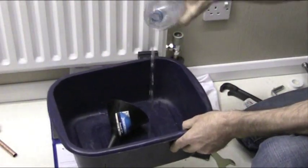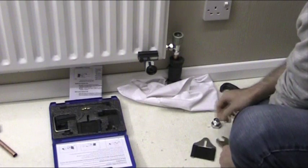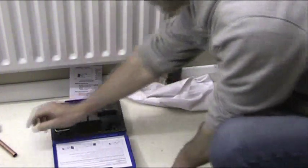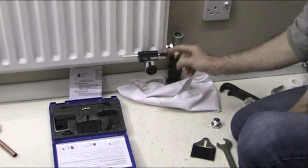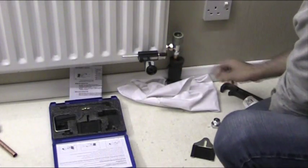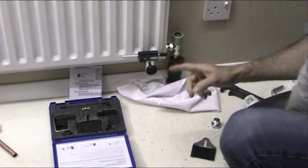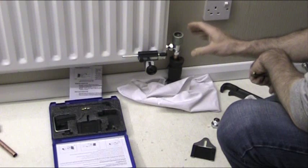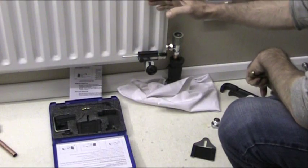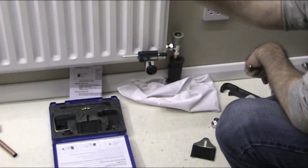Just to show you that it's not a trick bottle. So like I said, the next thing to do is insert the slide rod inside the clamp, going left to right, and just leave that there for now. Don't panic when you're doing this — when you undo the connection the water won't gush out, it'll just try to dribble because you've got the vacuum in the radiator holding the water in. That's why it's so important to close off the bleed valve once you've let the pressure out.